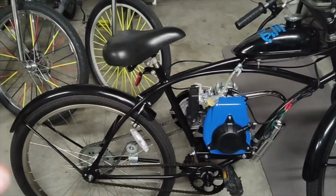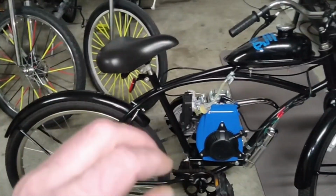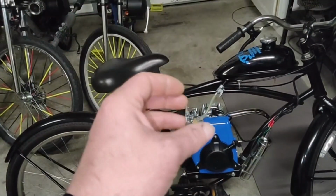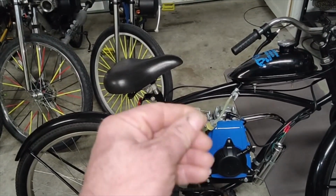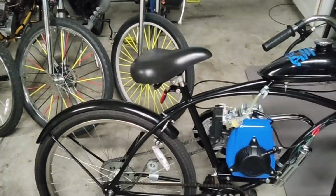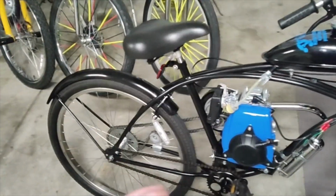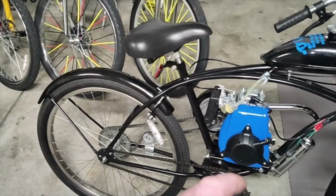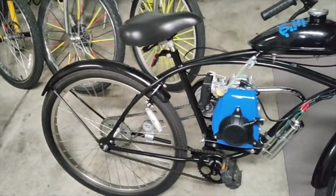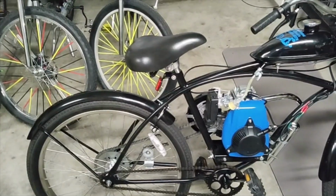We're gonna talk about valve float and all that, because it's 6,500, we'll say, because that's where it was maxing out. It was valve floating, and I'll explain what that is another time, but that's the limiting factor on this right now, and that's not a good thing. You don't really want to do that.